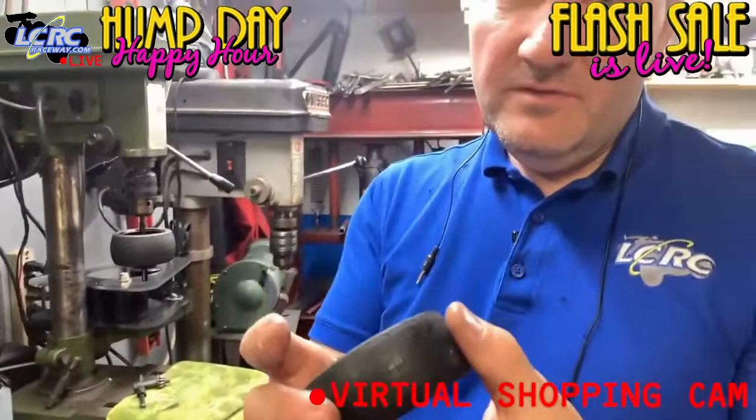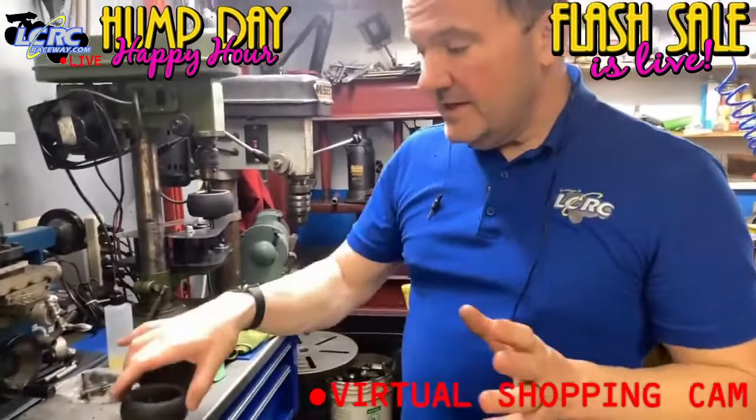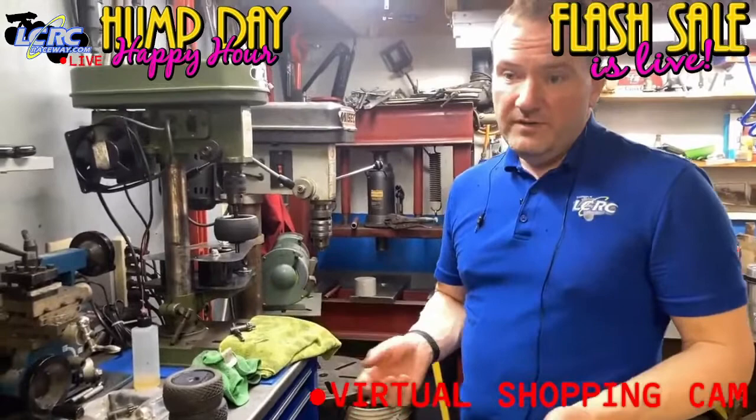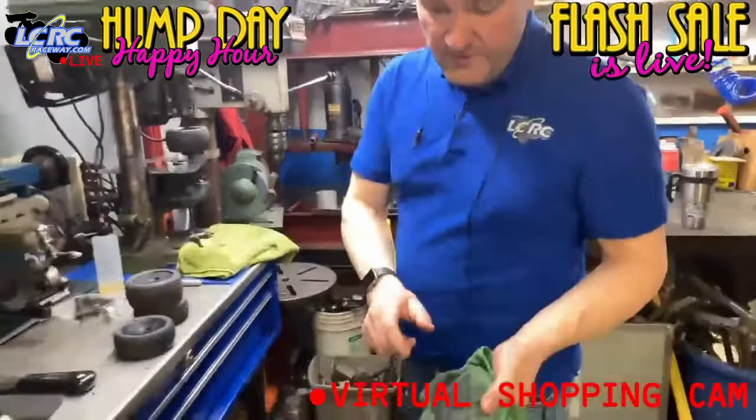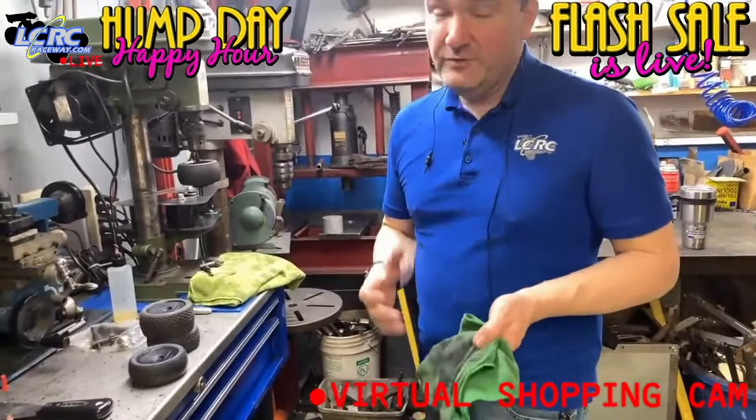Then that's it until the night before you're ready to go to the track. Then we do what we call the burn-in — you chuck the mandrel in an actual drill, take a microfiber towel, fold it up nice, spray it with aerosol liquid wrench, and take the drill and burn it in to where the tire is actually smoking — like smoking hot. What that does is the heat opens up the pores.